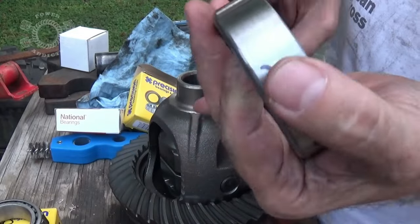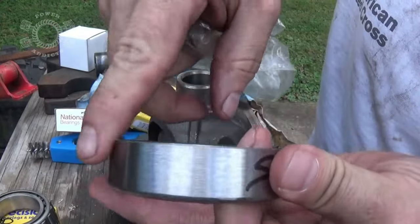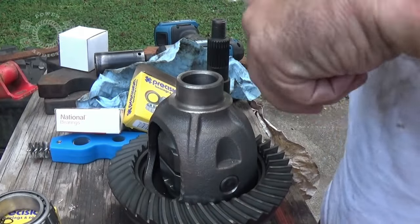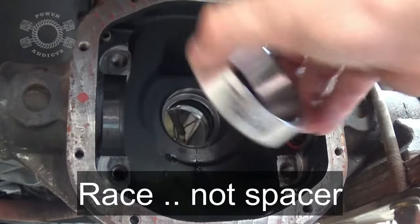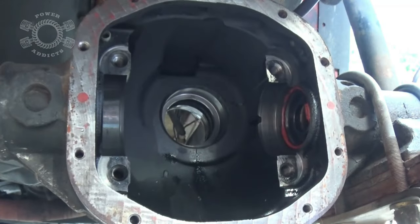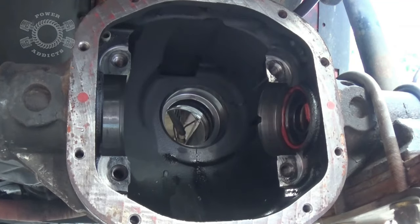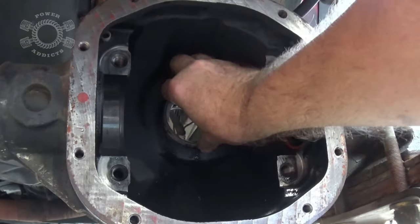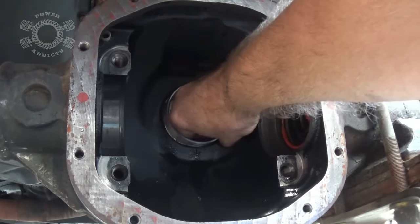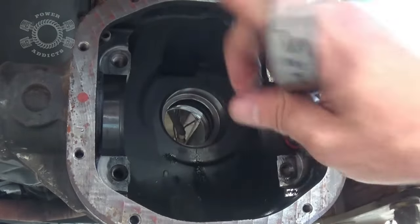In this video I'm showing you how to tear it down and what to do with your bearings to set all this up. The setup spacer goes between the housing, and you'll have a certain number of shims to determine during install. If you don't make a setup race, you'll be pulling it in and out until you get your preload set right. This setup race makes life a lot easier — just slide it in place, check your preload, if it ain't right tap it back out. Get your setup bearings done first; the next video is the actual gear install.